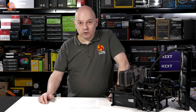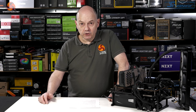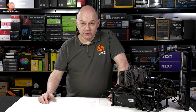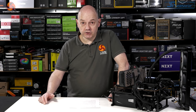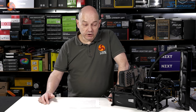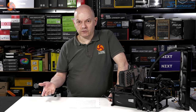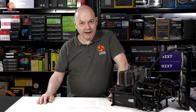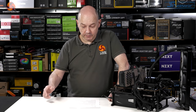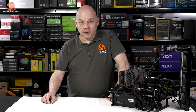So here are my detailed pros and cons for the Core i7-12700K. The i7 offers decent gaming performance. The combination of the 8 P cores and the 4 E cores is a decent combination. It's much better value than the Core i9-12900K. You can easily overclock it by 300 MHz. Again, this is significant. The i9, you can push it by 100 MHz, or mine at any rate, and it's a bad move. The i5, I could push by 500 MHz. This i7, exactly in the middle: 300 MHz, and it's a sensible overclock. And it runs nice and cool under load.